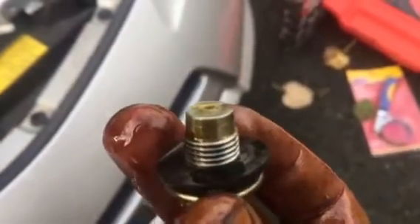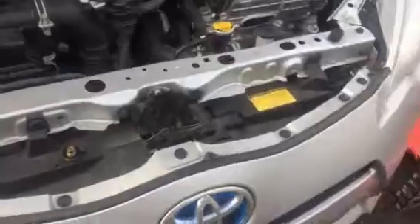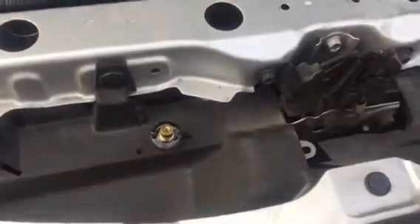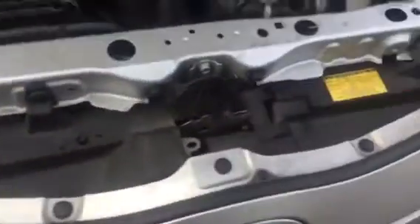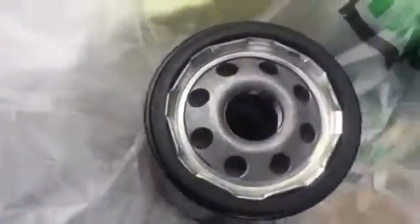That's the oil pan drain plug, and there's a washer right here. I haven't replaced this washer yet — it doesn't come with the oil filter unfortunately. I'll replace it down the road; it's a good idea to do it soon. The reason I'm not in a hurry is that these Priuses don't really leak. Make sure you lubricate the drain plug and also lubricate the oil filter seal with new oil before installing.